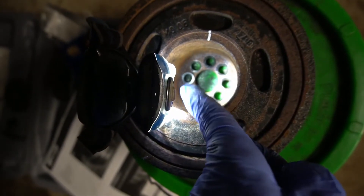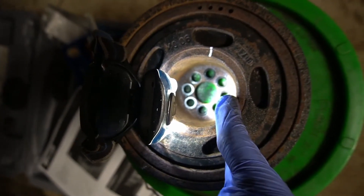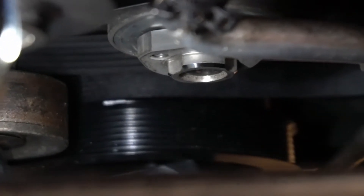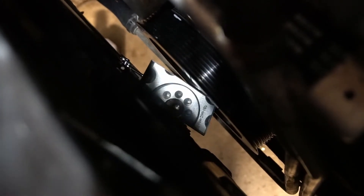I'm going to install the bolts in a star pattern, adding one bolt at a time and torquing it down as I go — that way I don't lose track of which bolts I've torqued. As you're installing the lower crank pulley, put the belt around it first. Using a mirror, you can see that the holes for the pulley line up. Install your new bolts with some Loctite.